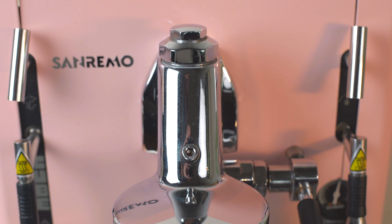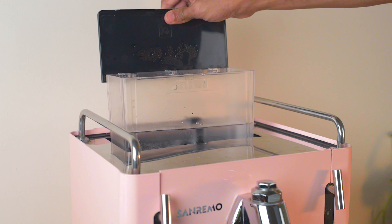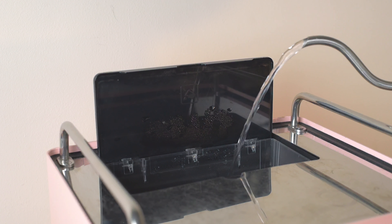It's really quite interesting how it works. So while you don't have the ability to set different temperatures for steaming and brewing, the PID allows you to set the boiler temperature quite accurately and gives you a rough estimate of the brew temperatures you can expect at various settings. When a machine like this is idling, the water that's sitting in the large tube gets overheated, which means a part of your next shot is pulled with this super hot water, making your espresso bitter and quite awful. The simplest way to avoid this is to flush the group head before pulling a shot to cool the water down to brew temperature. While older non-PID heat exchanger machines required long flushes of 20 to 30 seconds followed by a 15 second wait for recovery, newer ones like the Cube seem to handle this much better and only require a couple of seconds of flushing before you brew.